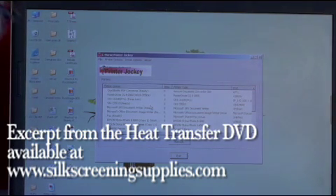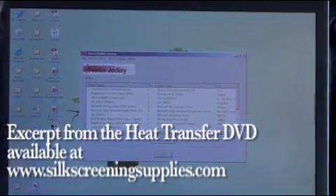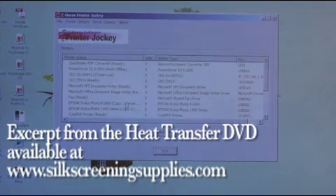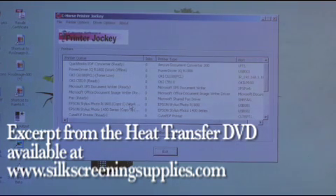This is a great advantage to sublimation and Chromoblast users because cleaning all channels even when not all are clogged wastes ink. With Printer Jockey we can use ink only on the channel we specifically need to. First, select your printer — not the Power Driver or Chromoblast driver printer, but the actual Epson driver for the printer you're working on. Note that Printer Jockey only works with the Epson 1400 or above; it doesn't work with smaller printers.